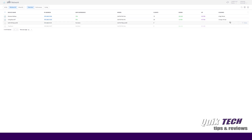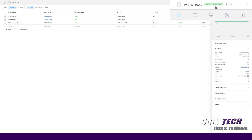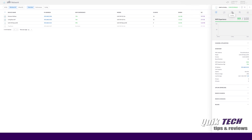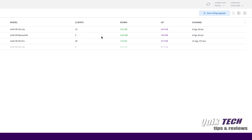Now that that's out of the way, we'll come up and click on Adopt. And now you can see it's provisioning. The beacon has been adopted successfully — the status here says 'connected wireless.' Let's click on the config tab and I'm going to give it an alias and call it 'lab beacon HD.' The beacon obtained an IP address from the server. It's got a 97% Wi-Fi experience, five clients, and here's the data going up and down. You can see it does have an upgrade available, so I'm going to go ahead and run the upgrade and I'll be right back as soon as the upgrade is completed.